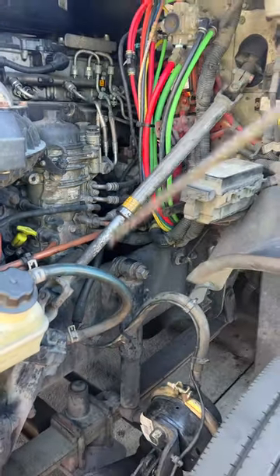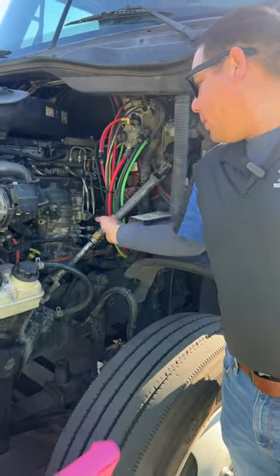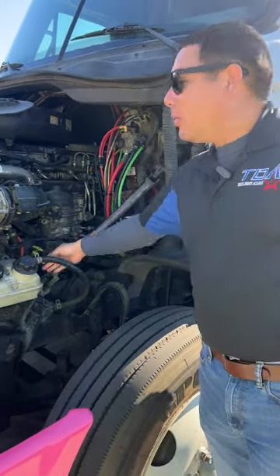And we come out here to our steering shaft. Our steering shaft is properly mounted and has not been broken or cracked. It does not have more than two inches of free play. Our universal joints are properly lubricated on both ends.